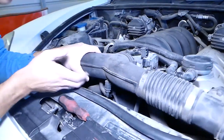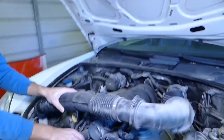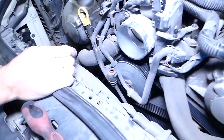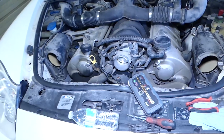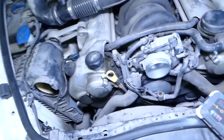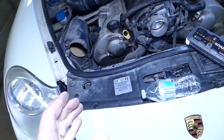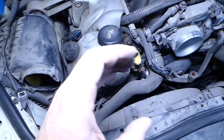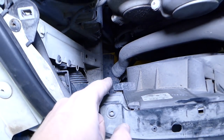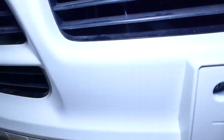There is one vacuum hose underneath that needs to be disconnected — squeeze the two tabs and pull it out. With the intake out of the way, we need to access the lower hose to drain coolant since ours doesn't have a drain plug. If your Porsche does have a drain plug you don't need to remove the intake, but removing it minimizes the risk of breaking the radiator hose and only takes about two minutes.